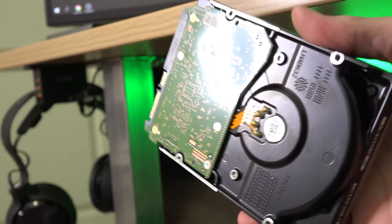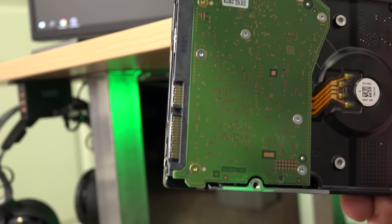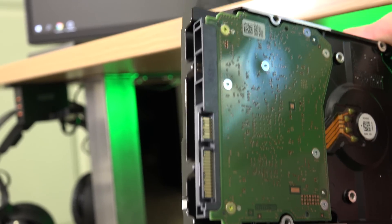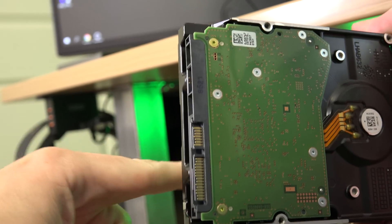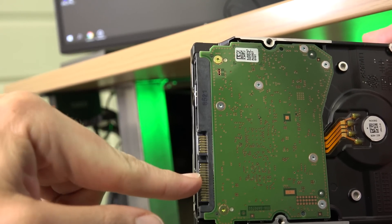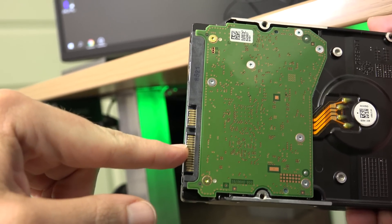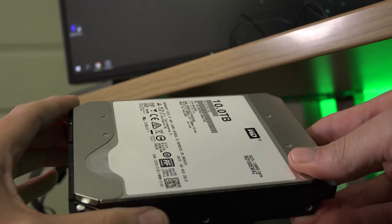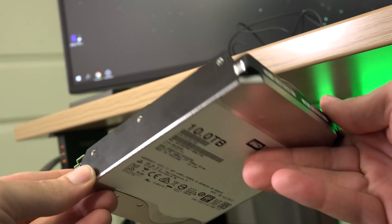One thing I'm not sure of is that these drives kind of randomly come with this 3-pin deactivation thing where it sends 3.3 volts to the hard drive, forcing it to reboot all the time. Meaning in order to get it to work you have to go in and disable the third pin — one, two, three — cover that up with a piece of tape or something in order to allow it to work in a regular computer. I don't know for sure if this particular drive is like that.